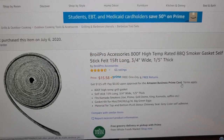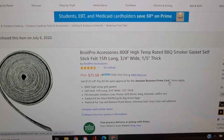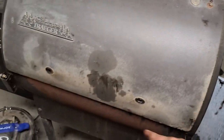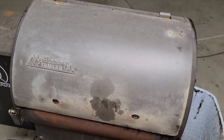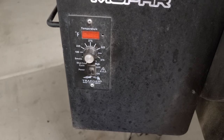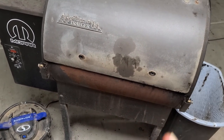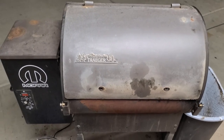One other thing I'm going to add to the grill as I redo it is this Broil Pro accessory — it's 800-degree rated temp smoker gasket. It's self-stick on the back and it's 15 feet long. What I'm going to do is put that on the inside of the lid all the way around to see if I can get it to keep more of the smoke in. This thing — I don't even know how old it is; I've had it for 7 years and the guy before me had it for 3 to 5 years, so it's at least 10 years old. I've replaced the controller with one that has a cooldown option — my original one did not have cooldown. I went through two heat rods before I realized I should upgrade the controller so I wouldn't keep having to spend that money.